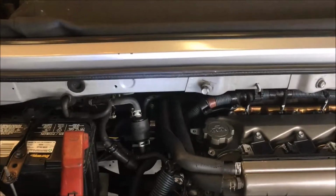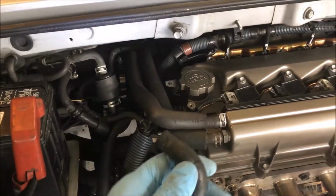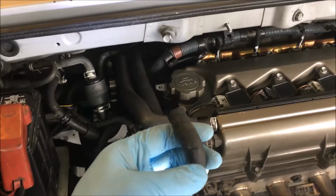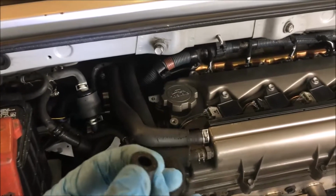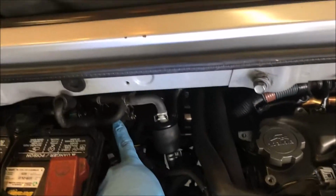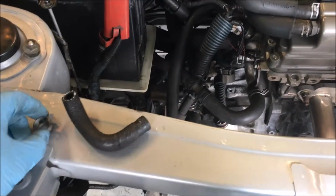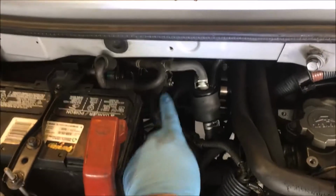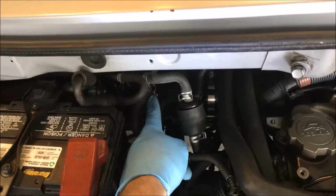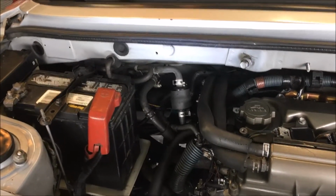I finally figured it out though, and I had a hose that had a cut in it right there. I think when I had pulled it off and moved the clamp back, it must have gotten cut. Then I realized when I went to check on it, this just pulled right off, so it wasn't sealing very well anyway. It was this one right here. And this is the clamp. It just wasn't tight anymore. That happens to these spring ones. The nice thing is I didn't really need that much hose. There was more hose there than you needed. So I trimmed it, cut it back, slipped it on, put a screw-on type clamp, and now I am not throwing a code anymore. So I am code-free.